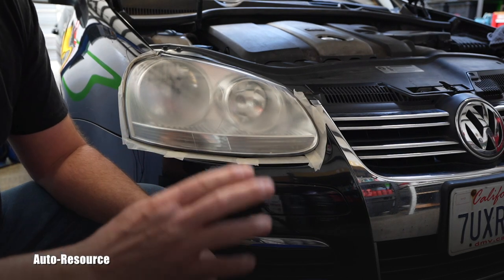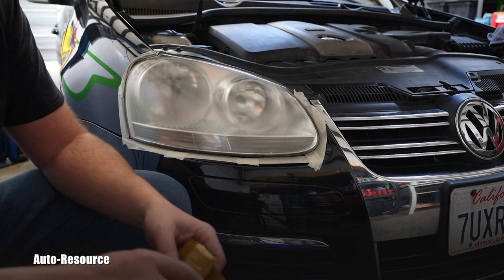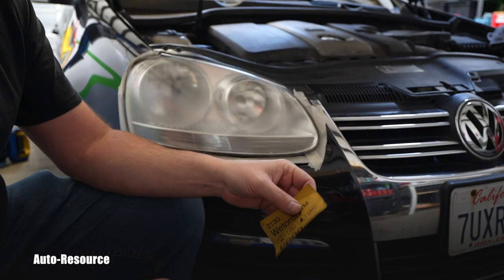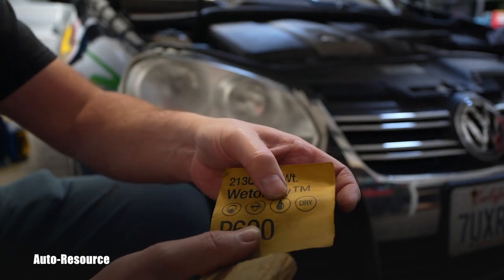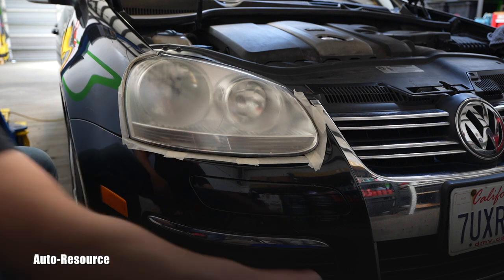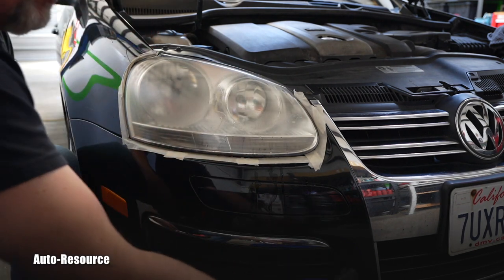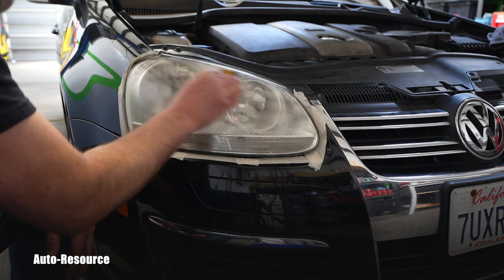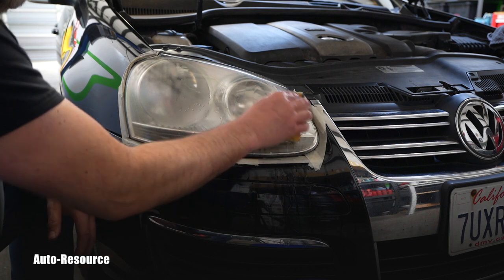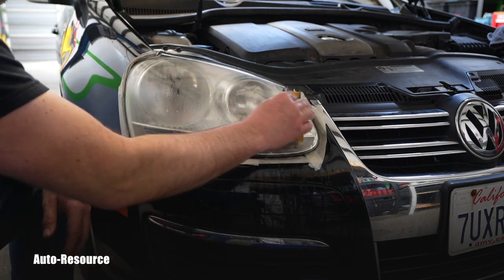Now comes the very important first step in the removal of that yellow bad stuff, which is making it so foggy. I will use 600 grit wet-or-dry sanding paper — wet-or-dry means it is made to be used in both dry and wet conditions. You will be using a lot of water; that is really important. Ideally, put some soap in that water to help lubricate the sanding process. I will frequently wash that sandpaper and this area too, to remove that yellow haze which you can see flowing down the lens.